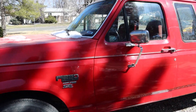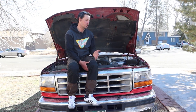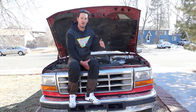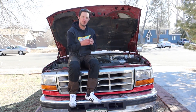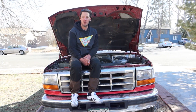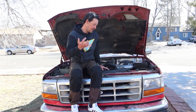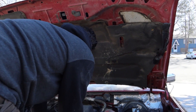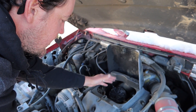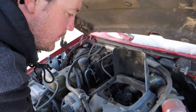The only ongoing issue — which happens with any vehicle, especially a truck this size — is that the fuel pressure can get low. It gets low if I switch to vegetable oil too early and the vegetable oil is cold. It also happens when the fuel filter starts to get clogged. At this point our fuel is probably cleaner than what you buy at the store, so at around seven to eight thousand miles the fuel filter will start to go. We've had to replace it in a parking lot — it's super easy, you just pop up this little lid and here's the fuel filter. We always have a couple fuel filters on hand so we can just pop the old one out, pop the new one in, and we're back on the road.